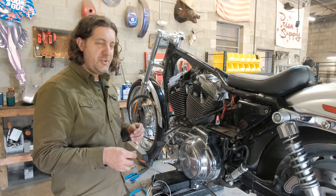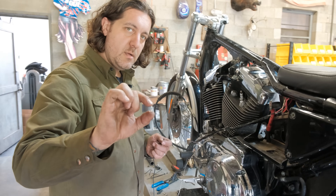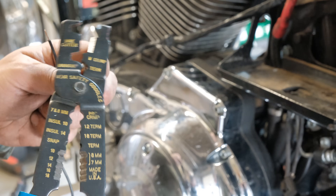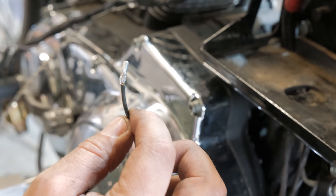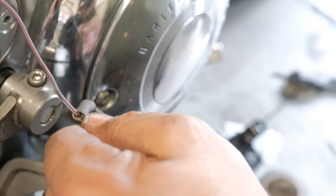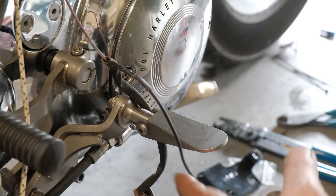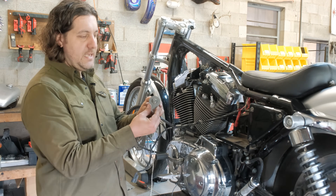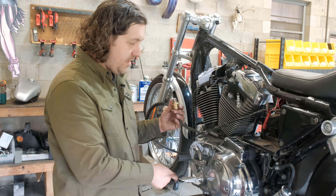Now I'm going to show the butt connectors that come with our electrical kit. Pretty simple: you get your standard pair of wire crimpers and an uninsulated terminal. Put it on, hold it, put your wire in the hole and squeeze. I'll put a piece of heat shrink over it, which also comes in our DIY electrical kit. Slide the heat shrink over and use a lighter, torch, or heat gun to fix it. This is our universal key switch mount, which we're going to use to mount it at the horn location — it's made to fit stock key switches, so that works out beautifully.